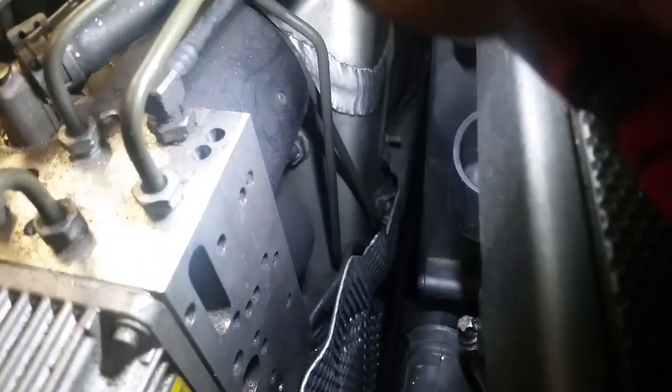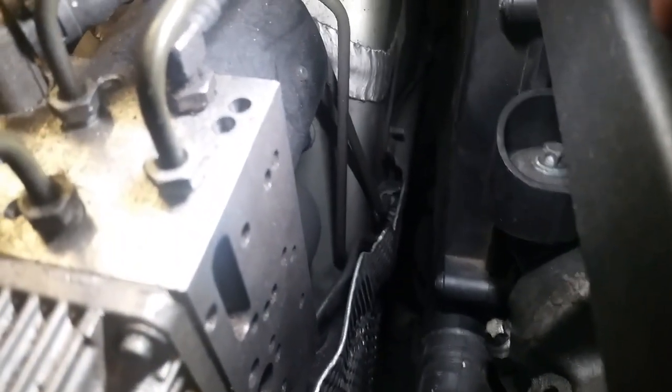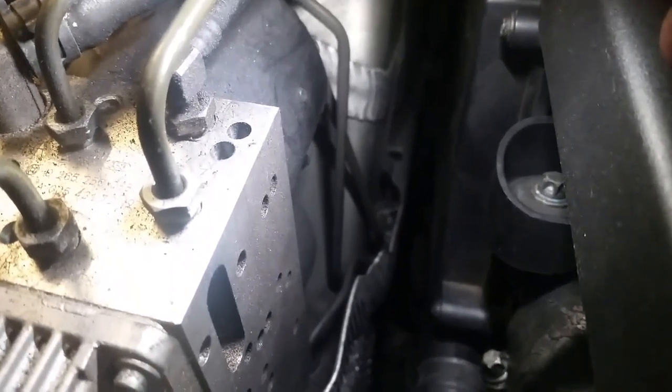So what it does is, in that black canister there's a motor. It's just an ordinary brushed motor, and in that thing down there is an accumulator which stores pressure. This pump has an ECU inside that controls the brakes. Whenever you press the brake pedal on these things, you're not actually directly connected to the hydraulics on the road wheels. So this thing opens solenoids and releases pressure to where the braking effort is actually required. It takes into account steering angle and road speed and slip and stuff like that.